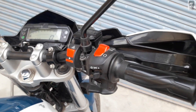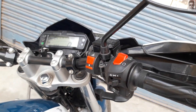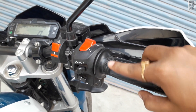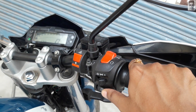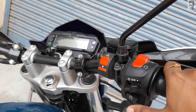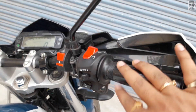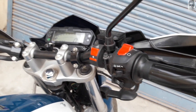When you roll the throttle and try to start the bike, it will not start. If your throttle is engaged — like you have rolled it — you can see these bars. I am rolling the throttle right now; if you try to start the bike, you can see it is not starting. If you roll it fully, the bike denies to start. When you release the throttle fully, the bike will start very easily.